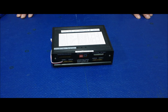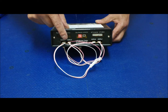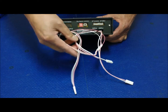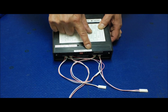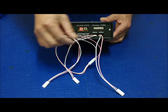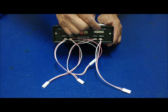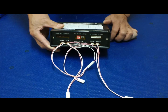When you purchase version 2, it will come with two extension CCFL wire cables connected to these four ports. There are a couple of reasons for this. If you see them, do not pull them out — just leave them as is. The label also says do not remove this CCFL wire harness. The first reason is to avoid constantly connecting and disconnecting, which can easily damage the female inverter connector inside the inverter. If you do get damage on this side, you can just order the wire from our website and replace it for a few dollars.